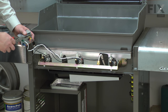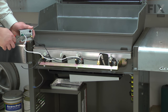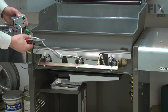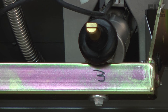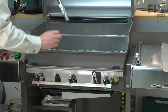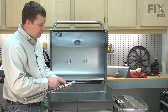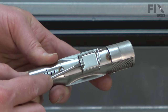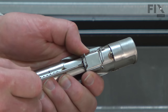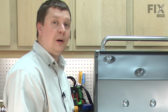Now remove each of the black wires from the ignition box and disconnect the white wire from the burner. Now I can remove each of the burners from the grill. Now remove the igniter and igniter bracket from each of the burners. The igniter just pulls away from the bracket, and the bracket is secured to the burner with a little tab. I'll use a small screwdriver to pry the bracket away from the tab; the bracket pushes away towards the back of the burner. I'll repeat this process on the other two burners.